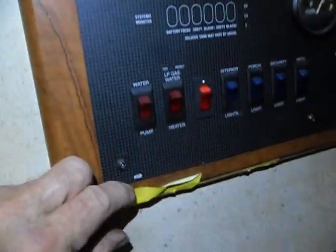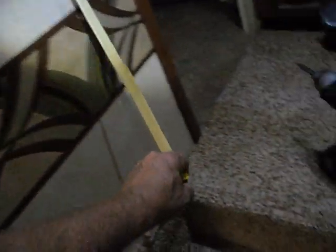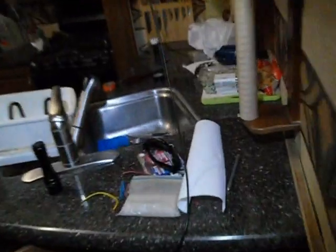Also, when you're working on this and the molding, notice there's masking tape protecting it. What most people don't realize is the RV industry uses MDF with a paper wood-grain finish on it - fake wood grain. So this is just MDF, which is basically particle board and glue, with a nice fancy finish. It doesn't take much to scratch it. Protect this wood because it's fake and doesn't take much to mess up, especially when the water heater leaked.